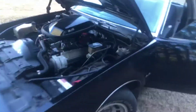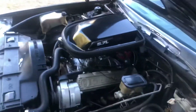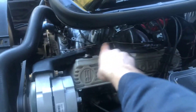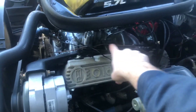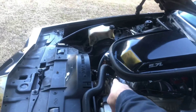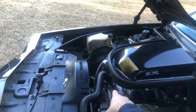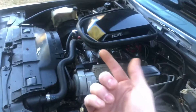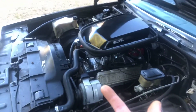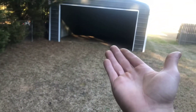I still need to do it the right way — that's next on the list. Due to COVID season, it's been sitting for seven months. When I cranked it up, the intake was leaking oil all up here, it was leaking radiator fluid from the neck seal. I had a Holley 750 carburetor which was also just pissing fuel everywhere because it had been sitting for seven months inside that dungeon.